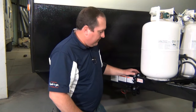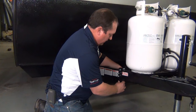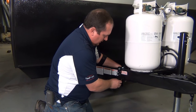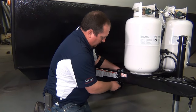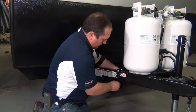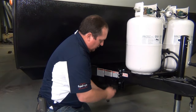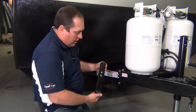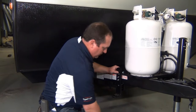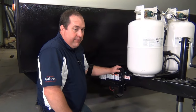Now I'm going to put the other nut and washer on the back of the bottom bolt. When you're tightening these up, don't just tighten one all the way down and then go to the next one — alternate back and forth. Make sure that you pinch them and bring them up tight to the frame first so they're on straight, then go ahead and torque them down. These will be torqued down to 65 foot-pounds with the torque wrench. Once those are torqued down, you need to install your L-bracket. I like to start right here in the center section — that gives me adjustability up or down if needed. Tighten those down with the nylock nuts that come with the set. Those get torqued down to 75 foot-pounds in the end.